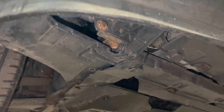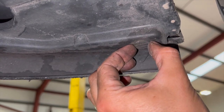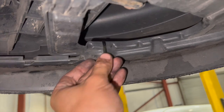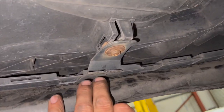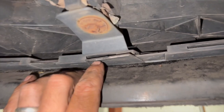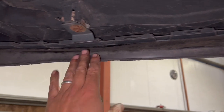Coming up underneath, this one's been beaten up and has a lot of cable ties on the trims. For the arch liner clips on the outside, use a flat blade screwdriver — there's a rivet where you flip down the center to pop the clip out. Along the bumper there are a few 10mm bolts at the front; on this one both are already broken off. There's also a clip at the back which is a cable tie — those are all the clips to detach from underneath.